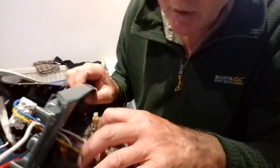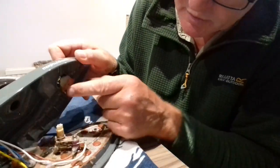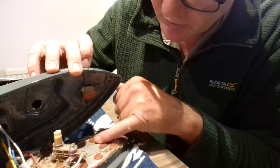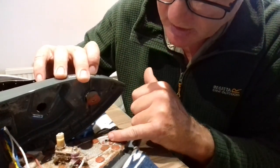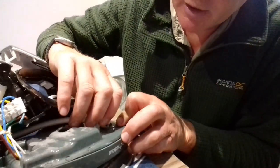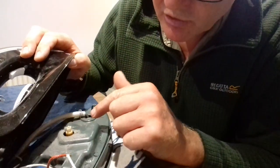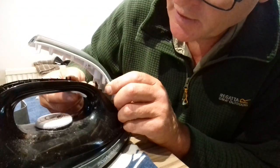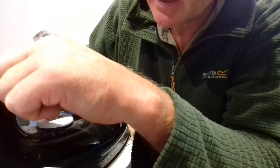This is just a quick video to show the disassembly. When you put it back together, screw that back on, clean all that muck out of there, drop that on. This little bit here is where the steam comes through — and this is why there's so much steam in here, because eventually this is probably glued on there. With all the heat, that glue goes, so you get a lot of steam dissipating through the bottom. As long as you put the plate back together tight it's going to be exactly the same as before. Pop that back on, realign it, put your three screws back in, put the top back on, three screws back in. When you put your switch back in the top, make sure that little spring aligns with the switch, and make sure you lay the cables in properly from the switch so they tuck right down the back — no chafing, and the white cables aren't getting pinched anywhere.